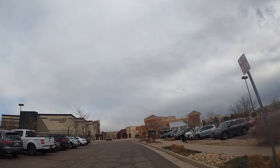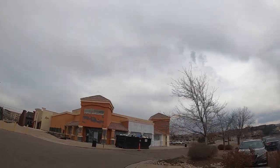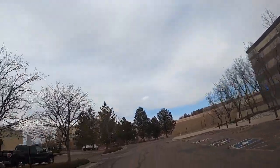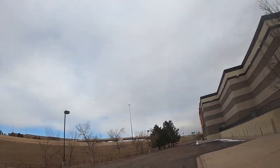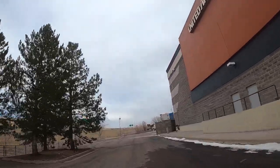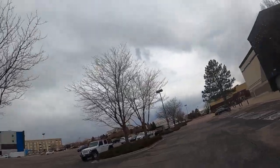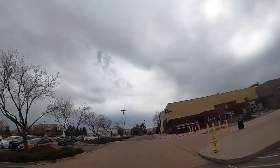Yeah, so bike feels great. Response feels good. Definitely got some future plans. But yeah, this chain setup, so far it's been handling the 150 amps peak I put on it. Also, pretty cheap setup if you have a Vapor motor or any of the same brand, my 1020 motor. They already come with T8F sprockets, so that's what I used.